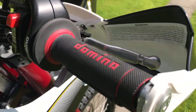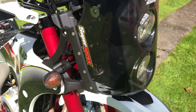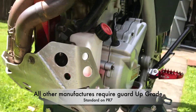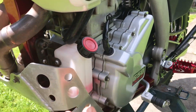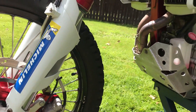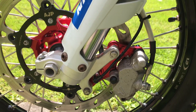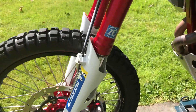This is the way the bike comes — it comes with these Acerbis guards with aluminium through them, and a cracking Rally tower on it. It comes with a substantial sump guard on it compared with other models — look at that sump guard, it's a corker. There's obviously a risk of the header pipes getting a knock, and this overflow expansion bottle looks exposed, but it's flexible so I don't see it being an issue. The standard pegs are fine. Now this is the 2019 model — 2020 comes with Brembos, but these brakes are adequate, bordering on slightly wooden. Whether it's a different pad compound I need to change, I don't know, but I can live with that all day long.